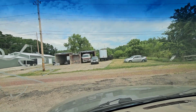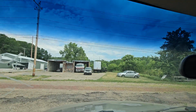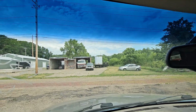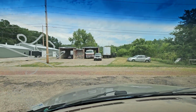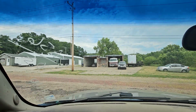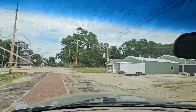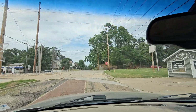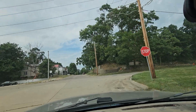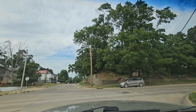We might have that chime the entire time with the brake light on, because when that brake light's on, the computer tends to think that the parking brake is on, and it's not on, because I double checked that. But it tends to think that it is, and so it warns you, hey, brake problem, brake problem. So that alarm is going off. We'll see if it stops, but brakes need to be serviced immediately anyways. So that's kind of going to be something that goes away with that service.